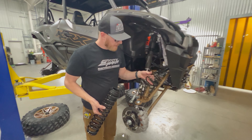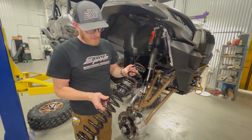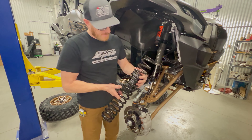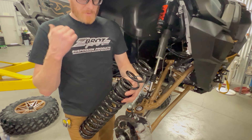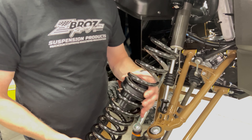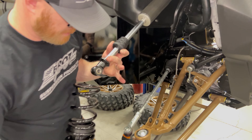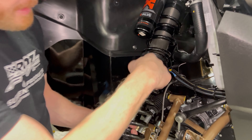Locate your front tender and your front main. The front springs are easy to tell from the rear because the front springs have a three-inch ID and the rear are much bigger on the ID for this particular application. Make sure your divider goes back on facing the same direction — the long lip is going to be facing down.